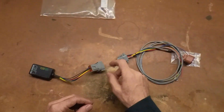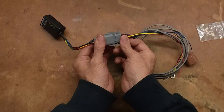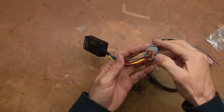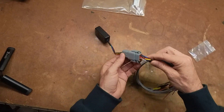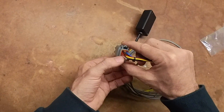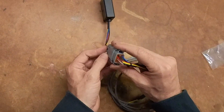What you'll find when you get your flex fuel: the first thing you're going to want to do is connect these connectors. You're going to want to take a look specifically at the black and brown wire. The black wire is in pin 7, the brown wire is in pin 6. You're going to want to look over at the other side and see what is in pin 7 and what is in pin 6. Pin 6 is this white wire — it aligns with this brown wire, that's how it's supposed to be.